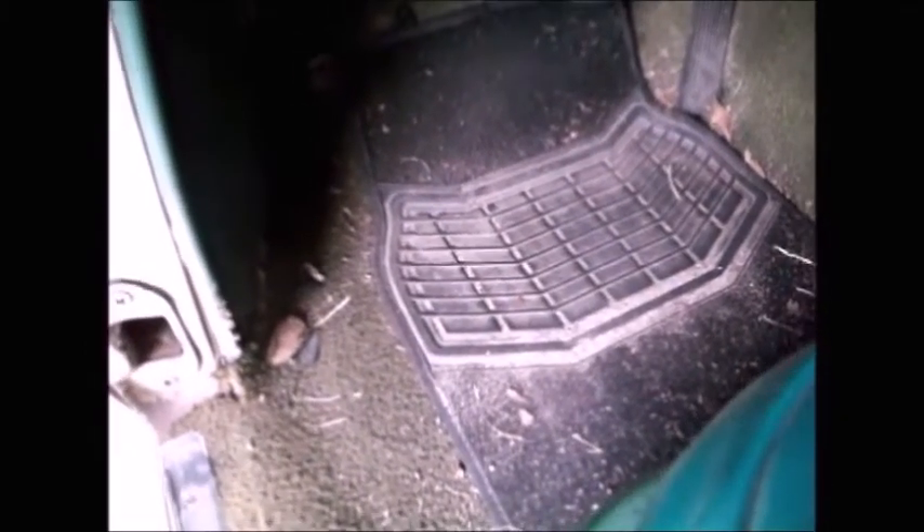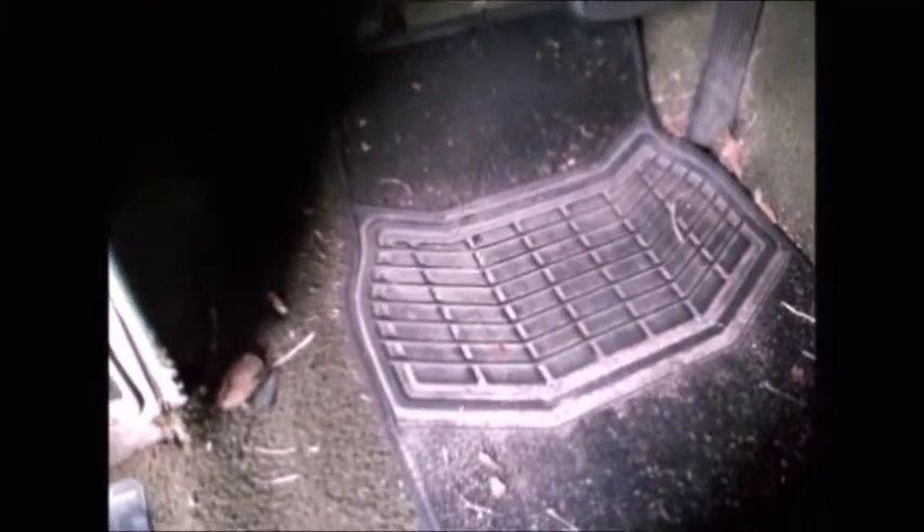So I figured that it's down here, like a lot of these '50s cars, and like my '61 Studebaker. On the '61 Studebaker Hawk, here's where you add the brake fluid, because that's the master cylinder right there. I figured it's on the floorboard, down by the brake pedal, there's going to be an access panel. So I pulled the carpet up, which was easy enough to do — but there's no access panel. So I jack up the car, get underneath, and figure out where the brake line's going to. It's jammed underneath the steering box for the power steering, and that's where you add the brake fluid — right in there with the air cleaner installed.